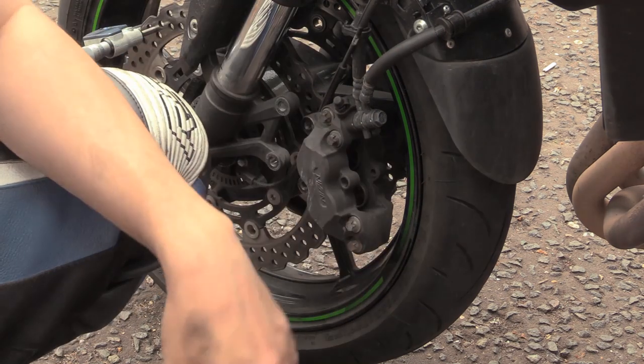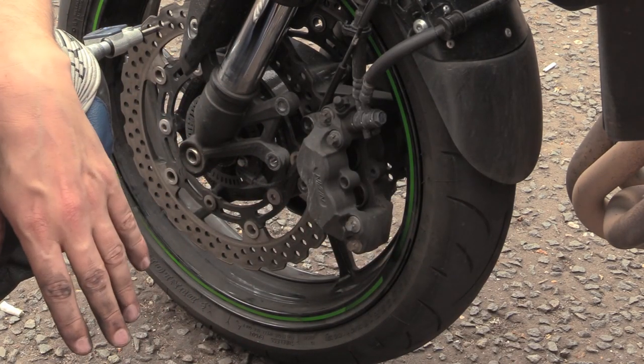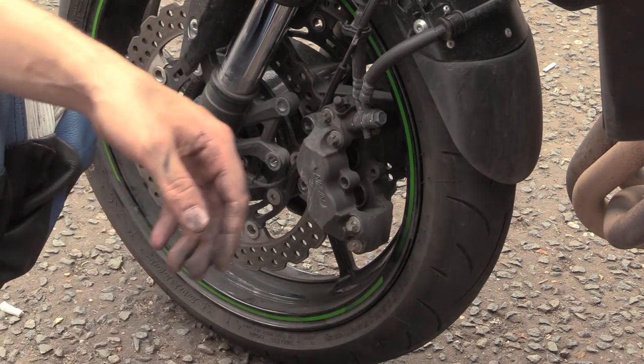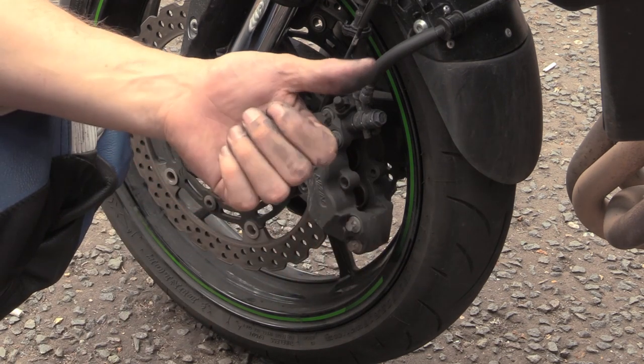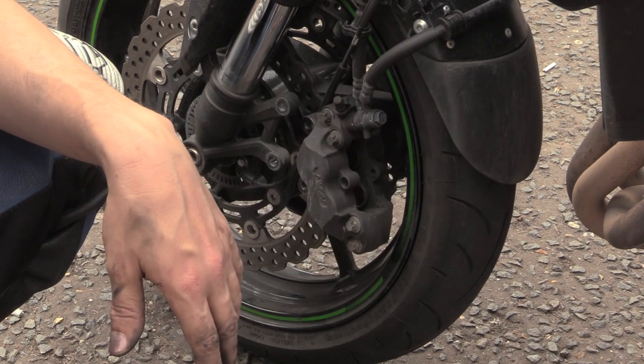And even when you get to 4.5, you can ride them at 4.5, it's just any lower. They'd just feel a bit iffy. No, they wouldn't feel iffy, they'd feel exactly the same. The disc is just getting thin, which means there's more of a tendency for it to heat fade quicker, and more of a tendency for it to warp.